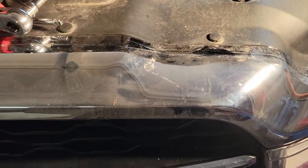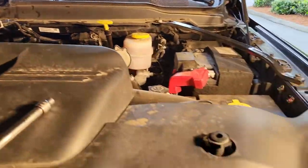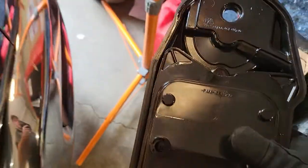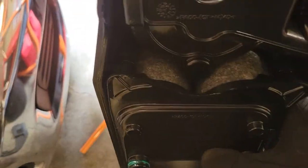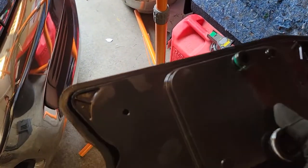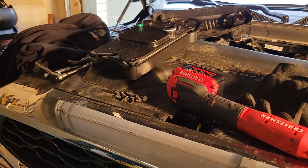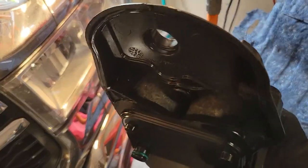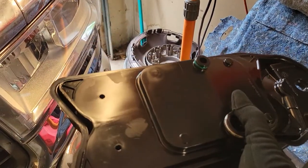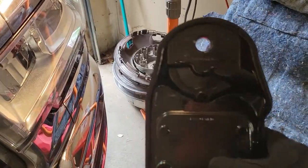I'm gonna throw on a pair of gloves and look at the old filter so you can see a solid comparison about how important changing this filter out on the top of your motor actually is. This one acts as an oil catch can — you can see residual oil on it inside, it's absolutely disgusting, and it's heavy. Brand new it's probably a little less than a pound; this one feels like two pounds with a lot of absorbed liquid inside. It's very important to swap this out frequently with your diesel engine.